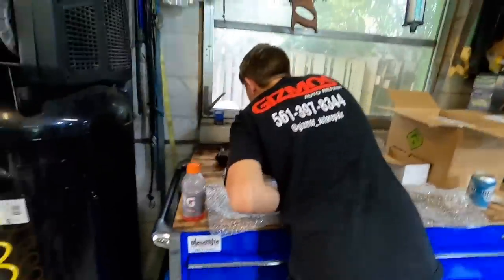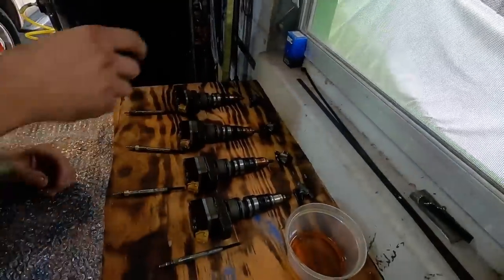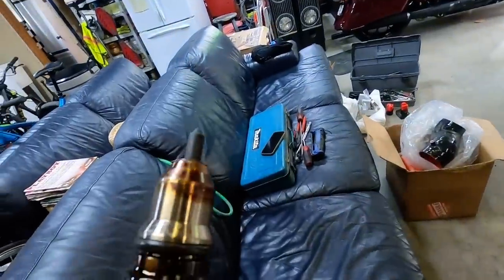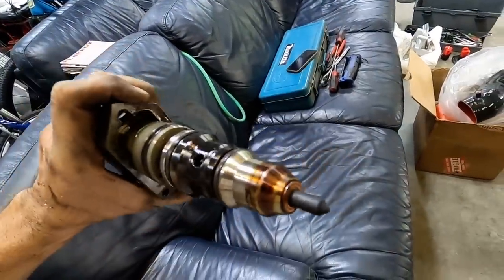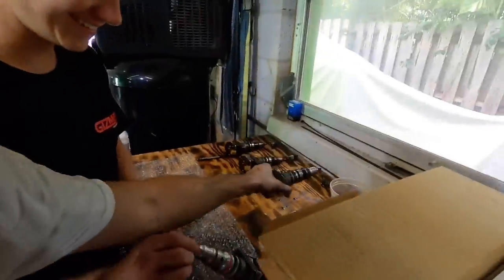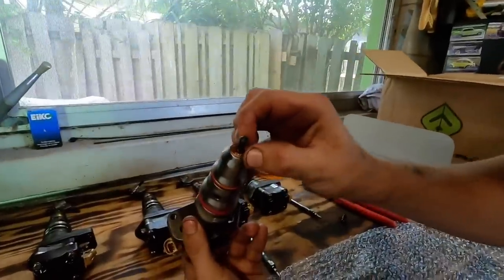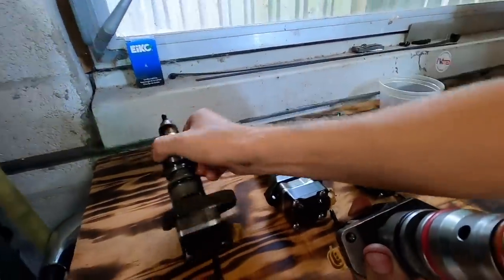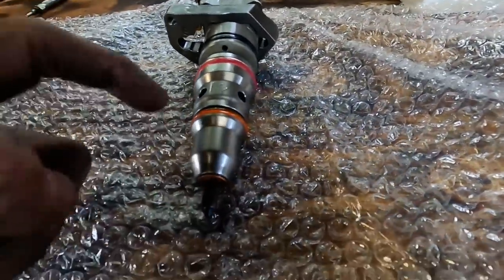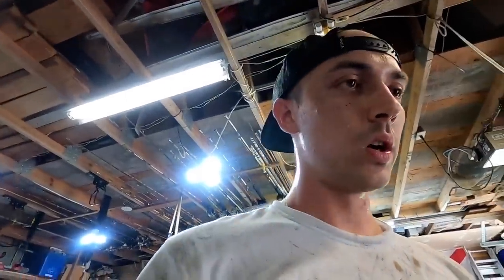While Tim's got the camera and Frankie's leaning over the engine — Frankie's got the system down, you guys have seen this before. These are 315,000-mile fuel injectors that actually look pretty good — just your average wear. You can see some oil burning at the bottom of the injector tip, but overall they look pretty healthy. Also one thing I was checking for: this little copper O-ring — I was double-checking to make sure all of them came out with the old injectors so we don't double up on the copper O-ring. If you double those up, the injectors will not sit properly, you'll leak fuel and oil into the cylinder, and you have a really high risk of hydrolocking the engine. You can bend a rod, so we try to avoid stuff like that.